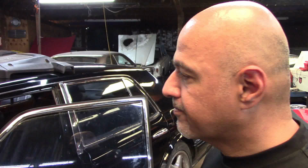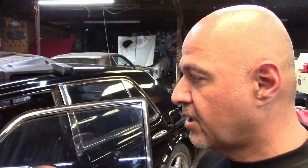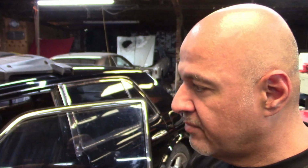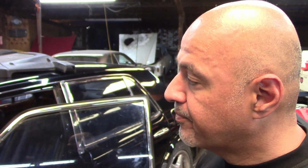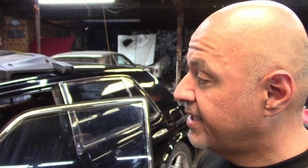Alright guys, so I was running it, I couldn't find the injectors. I know that they're down there, but I couldn't find a way to access them with my probe, with my stethoscope. But something weird happened. While I was running, it was progressively starting to run worse. And then when I did check the O2 sensor on the scan tool, it was reading 1.27 volts, which is way rich.